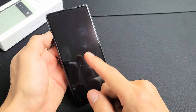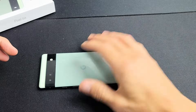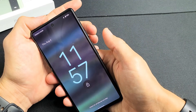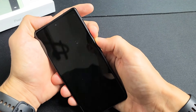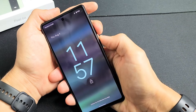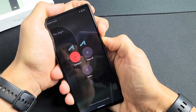So let's pretend I'm still stuck in the boot loop. The first thing we want to do is force restart it. Also, if you have a case, take the case off right now. It's a two-key combination using the buttons: hold the power button and the volume up together. Press and hold both buttons and do not let go until you see the Google logo appear, then let go. Keep holding and wait — at least about 10 seconds.